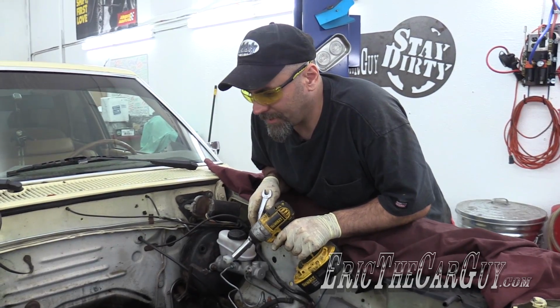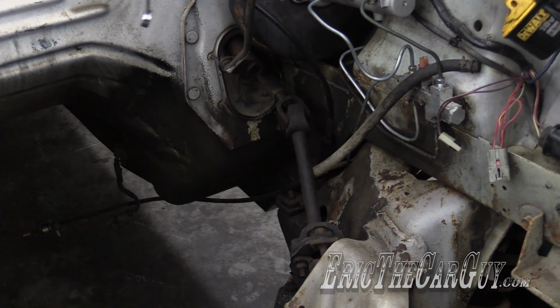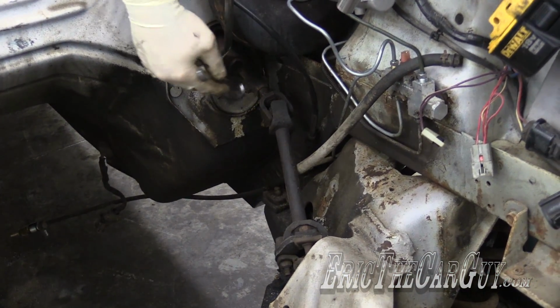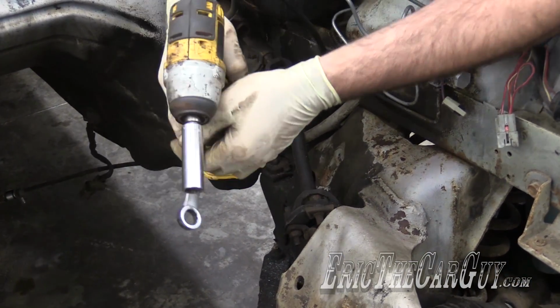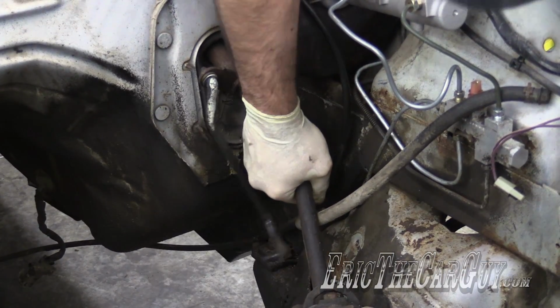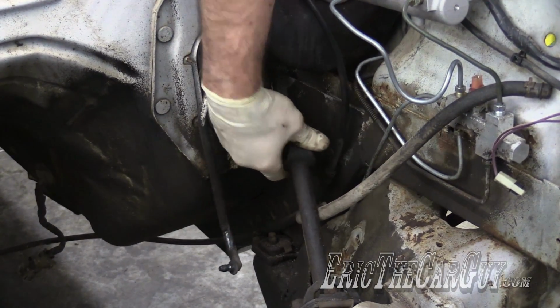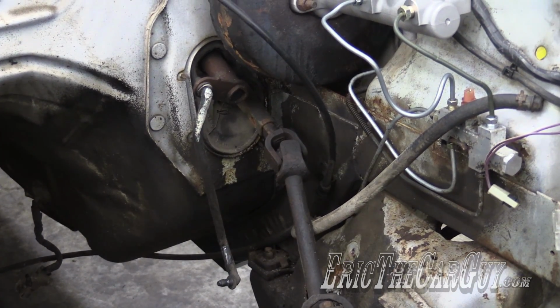One last thing connecting us to the body is called the sector shaft that goes to the power steering rack. I'm gonna be replacing from here down anyhow. And so, 9/16. Oh yeah, that should come out of there okay. Feels like it will. I'll leave it with some penetrating oil just to be sure.